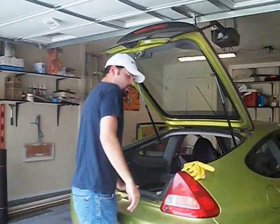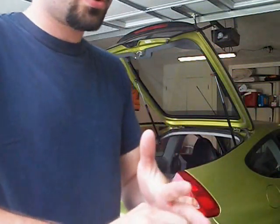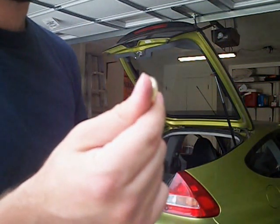Something you'll want to keep in mind is you're dealing with a lot of current here and high voltage — 144 plus volts — so having some thick rubber gloves is a necessity for this job. You'll also want to take off any rings, piercings, jewelry, or any other metal accessories you might have. Because if you get shocked, that'll leave a scar.